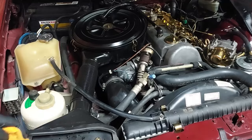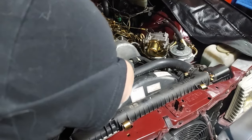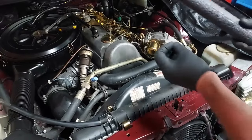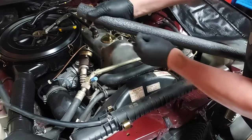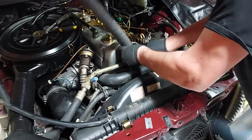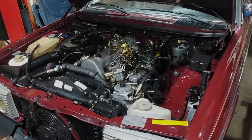The last thing is to change the original insulation around the AC manifold — you can see it's kind of crusty, the original stuff literally comes apart. We'll peel all this off and put on new insulation. The insulation is just standard pipe insulation — slice it, put one piece there and another one right over here, and that's good to go.